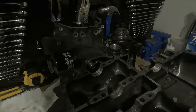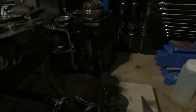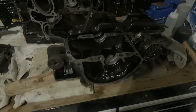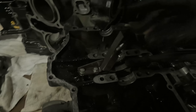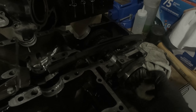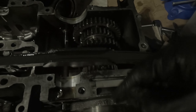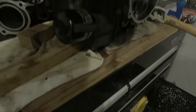Next, let's move to the bottom part and take out the gears from there. There's not much more to be taken off that part, so we'll swap things around and work on that. Here we have the other part of the engine — the bottom side. We have a bunch of chain guides and tensioners that need to come off, as well as the final gears over here. Most of it can be pulled out this way, but the bigger ones don't come out through that hole so you need to slide them off one by one.